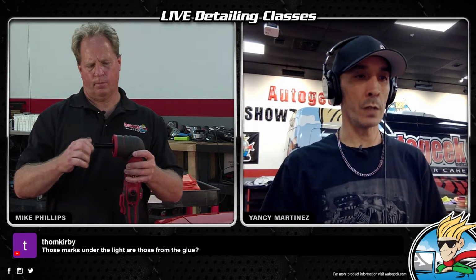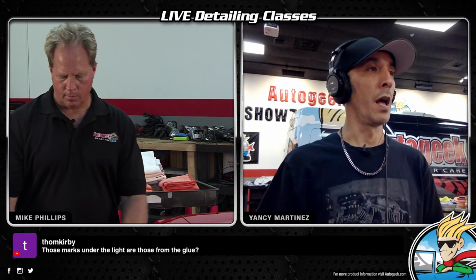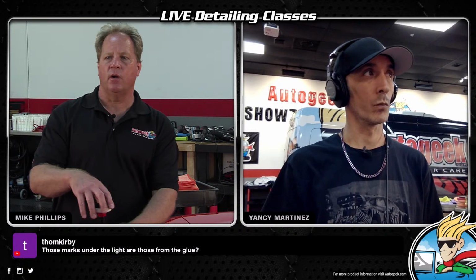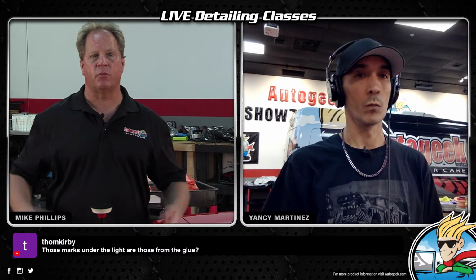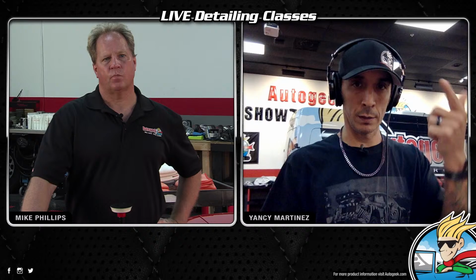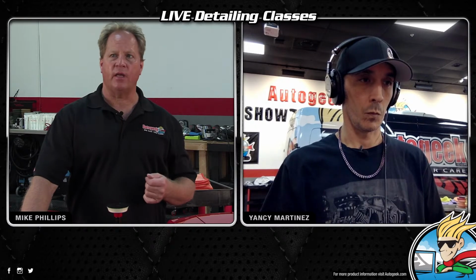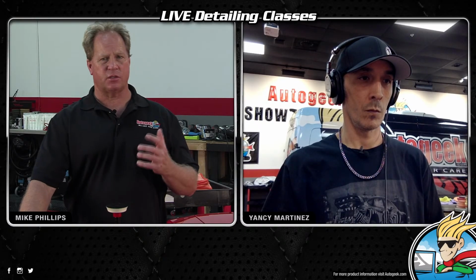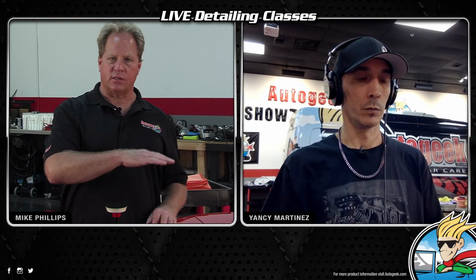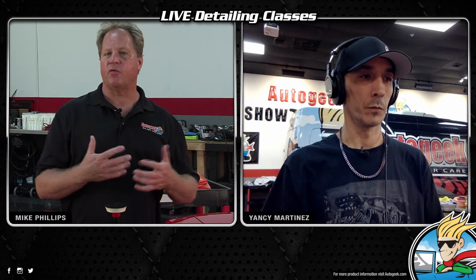Thomas Kirby, those marks under the light, are those from the glue? No, we removed the glue. How would you remove the glue? Once the emblem's off, if there's still some adhesive there, one of the best things to do is use some 3M adhesive remover. If you remember, we did an emblem removal on my Dodge Scat, and that video is in this live class. The trick to using 3M adhesive remover, or any orange citrus oil-based solvent, is not to put some solvent onto a cloth and rub like a madman. Put some on the cloth and hold it against the adhesive and let it go to work, penetrating into the adhesive, dissolving it, loosening it, then rub. So let time work for you. Have some patience.